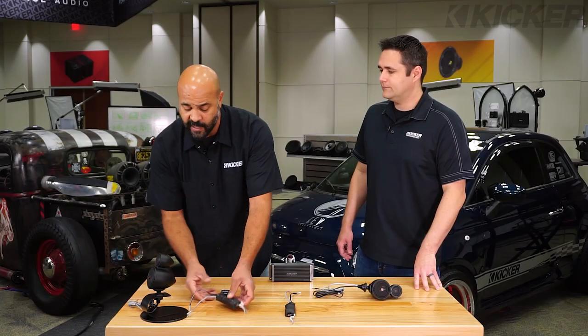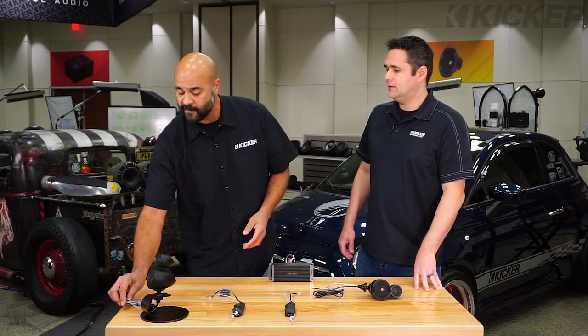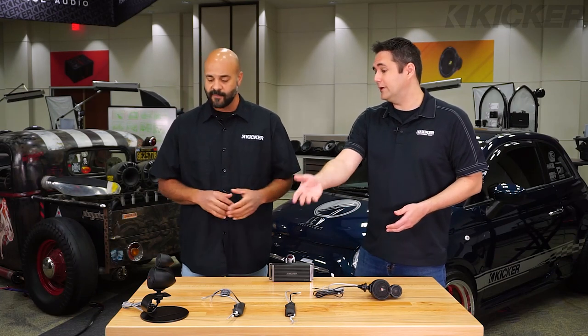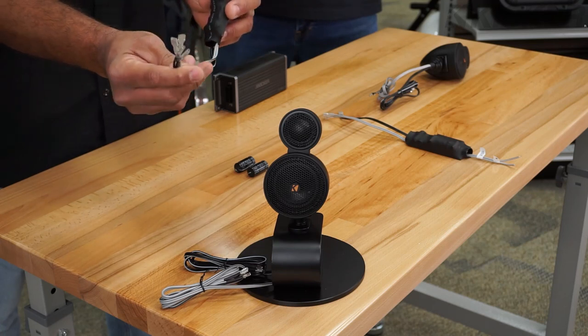We also have these two wires available, so if you want to bypass the passive crossover, you can use crossovers that are built into your amplifier and bi-amp. If you want to use a higher-end DSP system with separate EQ adjustments for the mid-range and the tweeter, separate gain and volume adjustments, you can dial that in with separate inputs for the tweeter and the mid-range. That gives you a lot more control — running the mid-range on its own amp channel and the tweeter on its own amp channel versus using one amp channel going through the passive crossover network.